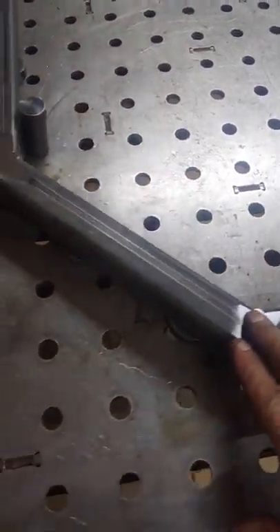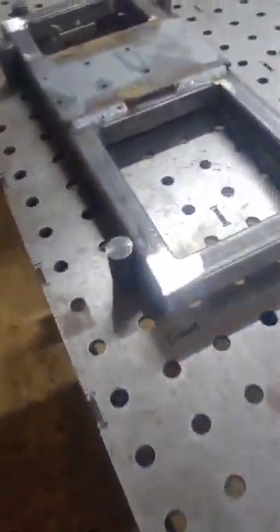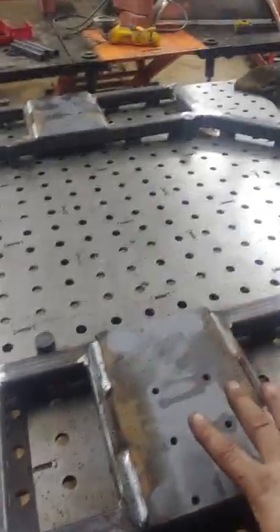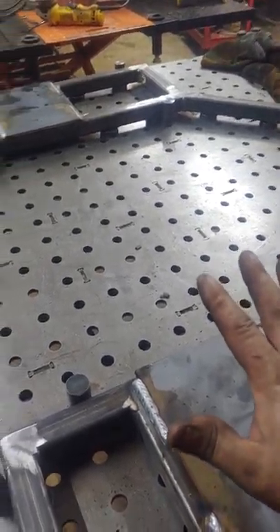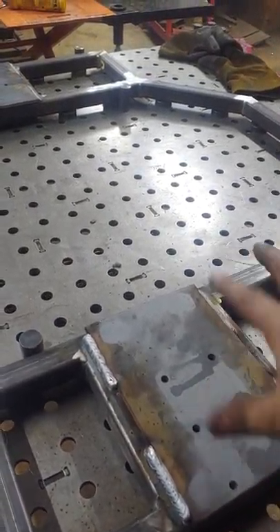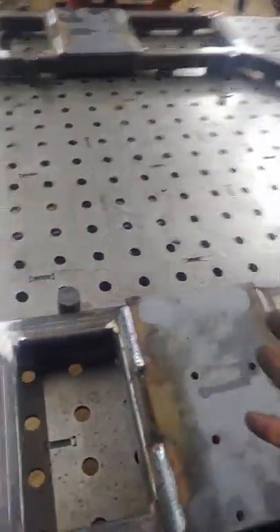Safe Auto Sales won't do this — they grind it down a little bit and put ugly expanded metal over it to try to hide their nasty welds. That's the reason why I've had so many people bring them to me with broken welds and twisted frames. They don't box it in. This little add-on here with the two pipes going across and this quarter inch metal sturdies the whole thing up so it does not twist at all. Safe Wholesalers' outlaw kit just puts a single bar in there and everyone I've had twists while trying to turn.